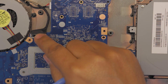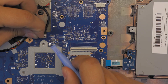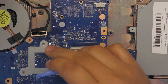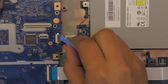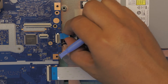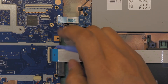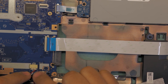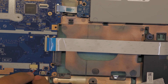For the screen cable, grab the flap and pull it towards the ceiling — pull it really hard and it will come out. For the CD/DVD-ROM adapter, lift up the cover and unhook it. Same thing for the extra USB and audio jack on the right. At the bottom, unlock the speakers by putting your nails between the plastic connector and pulling it out.